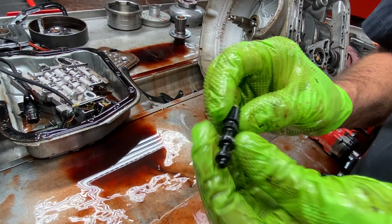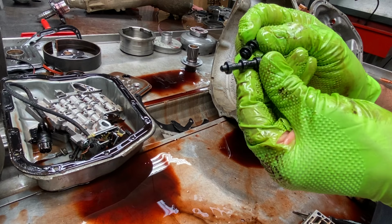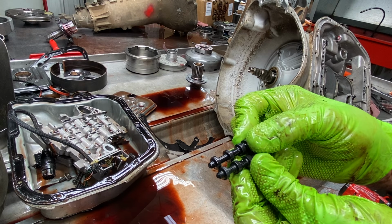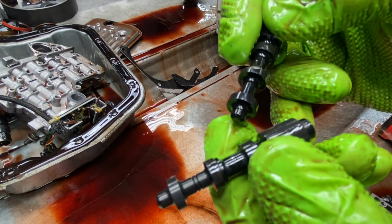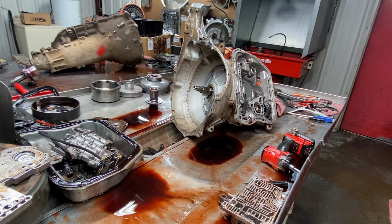The new valve, this is a brand new one too. If you look at this new one here, they almost do it for you anyway. These new valves are cut deeper than the factory valve. But you can see where they want you to come through here, but not that far, guys. You can go too far and just ruin the valve. See, but they already do it right there for you. So the new valve, you could just put it in the hole. Don't even have to touch it. So, pretty simple.